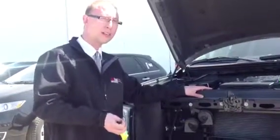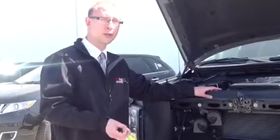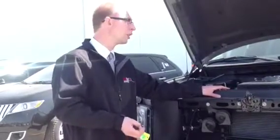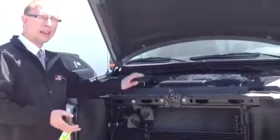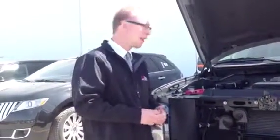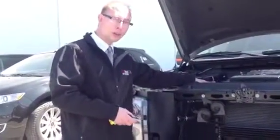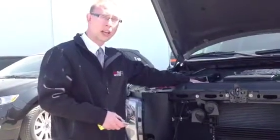They've torture tested it. They've got hot and cold testing that they put all of the engines through, and it's a good proven technology. The engine is mated to a 6-speed transmission. Again, that's going to give you a nice power curve. It's also going to give you a little better fuel economy as well. The fans are all electric-driven fans on it for cooling too, so you're not wasting any energy to the old clutch-style fans.